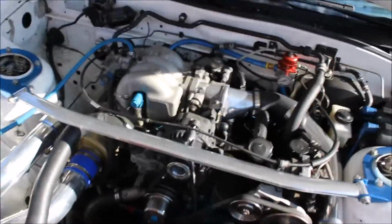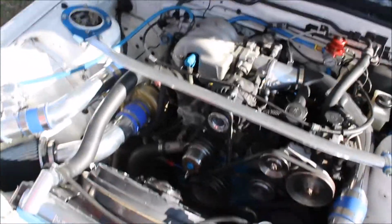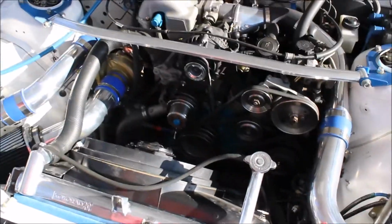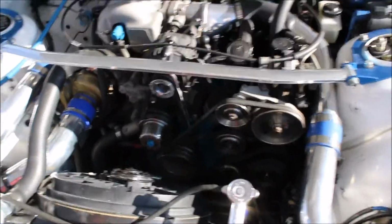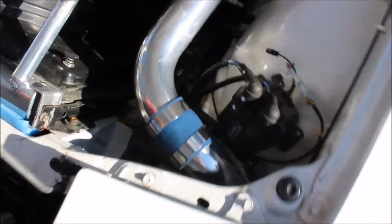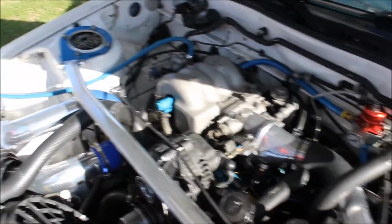Alright, so let's go with what's stock, what's aftermarket? Well, not too much is stock. It's got AC and power steering still. When we did the engine rebuild, it's got a mild street port from Pineapple Racing. It's got 3mm apex seals, I had it machined locally. Pretty basic rebuild other than that.